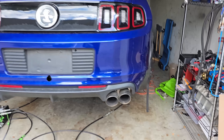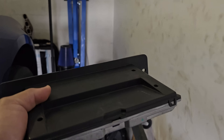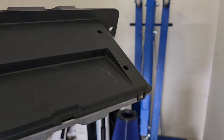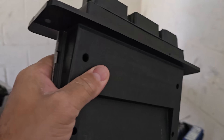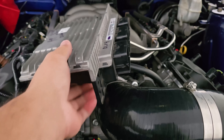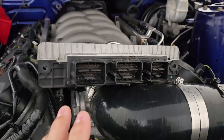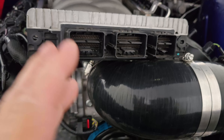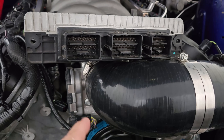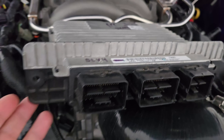New day with the coyote-swapped Shelby. Senior, being the boss that he is, got me a coyote PCM with some stuff in it so I can flash it. This is basically a coyote PCM BLV4 — this would be what comes in a '14 GT. BLV3 would be a '13 GT, so if you have a '14 GT this is what you'd get, manual of course.